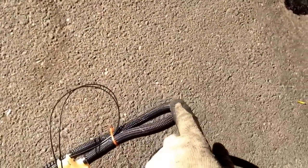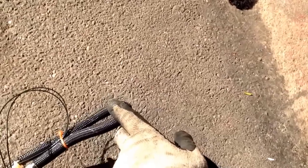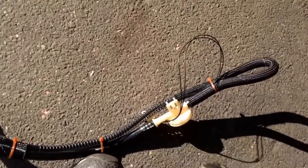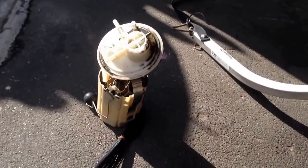When you first pull the pump out and start pulling this connecting piece, make sure you tie a piece of chain or string to it before pulling it out of the tank. You're going to use that string later — it comes out the other hole where the pump is. When you install the new fuel pump, begin by putting this piece inside and pulling it through the other side with your string, so that it comes out on the driver's side access door hole. That's where you'll attach this piece.